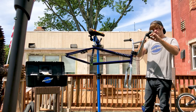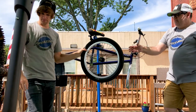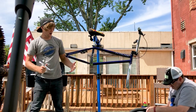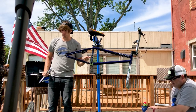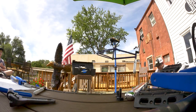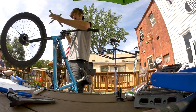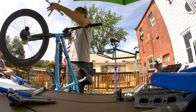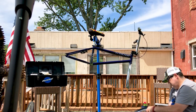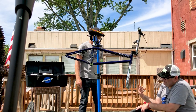Throw the front wheel back on. When it comes to front wheels, the wheel and rim itself is not directional as much as the tire is. If you have a directional tire, look at it — notice how it kind of looks like arrows. If there is a directional tire, you will be able to tell which direction should be forward and it will have arrows on the tire. When you're putting your front wheel on, just make sure you're putting it on with the right side facing forward. Front wheel dropouts are pretty standard and should be about the same size as your axle with enough leeway to fit the wheel.